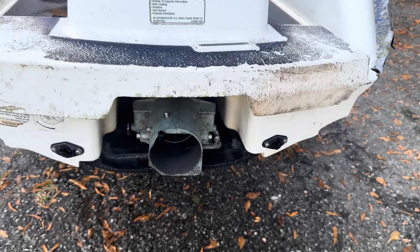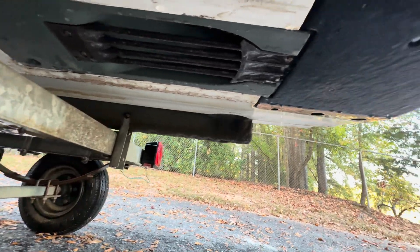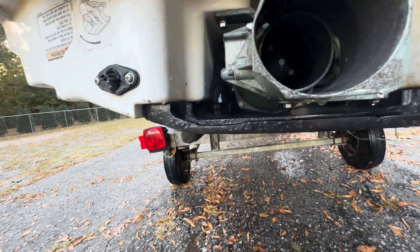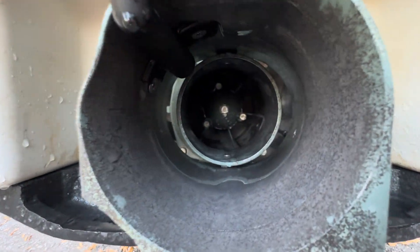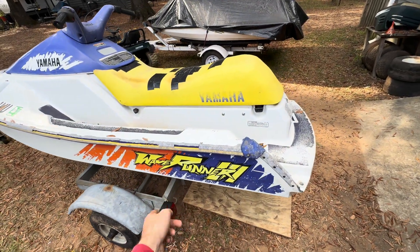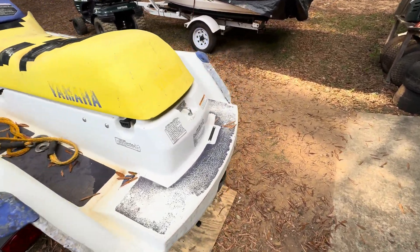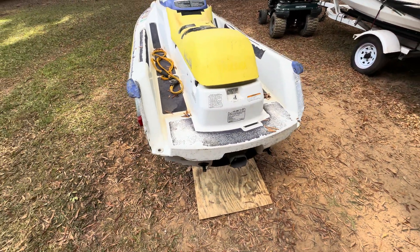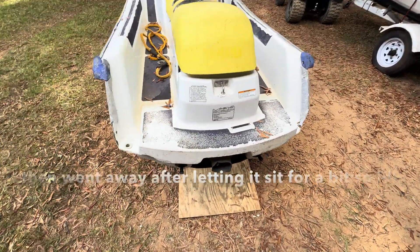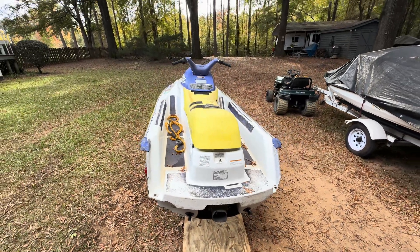So I cranked it up out of the water just to get any leftover water out of the exhaust and cooling system. Everything under here, from a first glance, looks fine — I don't see any major issues. A line fitting came undone. I did crank it up out of the water, looked at the impeller and the shaft — it seemed to spin very straight. Nothing looked really out of whack. Maybe the impeller came loose or something — that's my guess. So if you've got any idea what the heck is going on with that, give me a note in the comments, and I'll see you in the next one. Thank you.